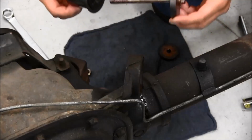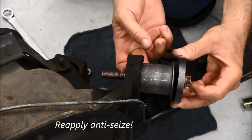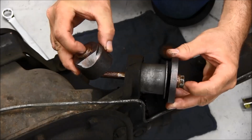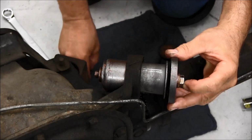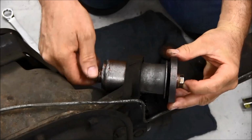Place the bolt and the 3 washers with a fresh coat of anti-seize through the large flat disc and then through the center crush sleeve of the new bushing. Then set the bushing against the housing. Place the bushing installation cup along with the 3 washers recoated with anti-seize in place on the bolt. The flat should be towards the axle casting. Thread the nut onto the bolt.